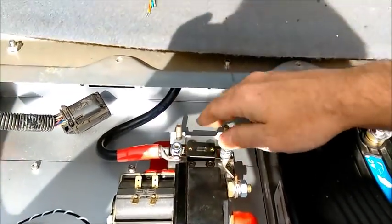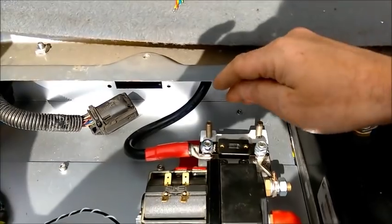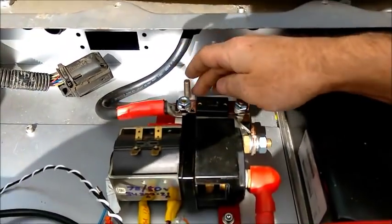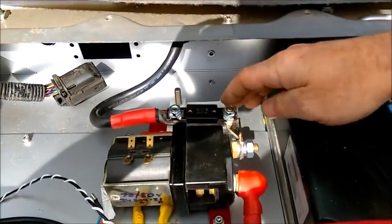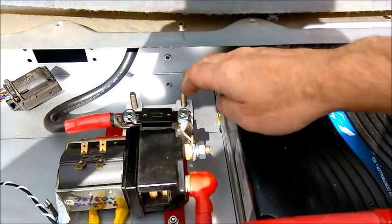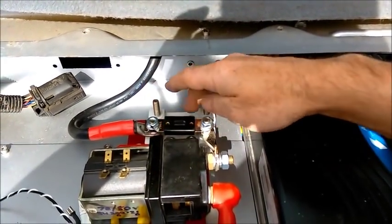The main power comes in from the contactor just towards the front, under the well, through the plate, through a grommet in the plate, and onto the fuse. So the main fuse is across there, then the contactor, then straight onto the controller. And I've got another fuse point here which I'll connect for putting the charge through.